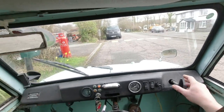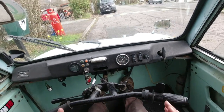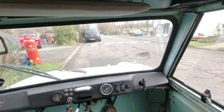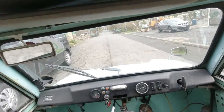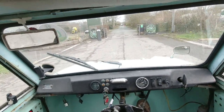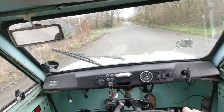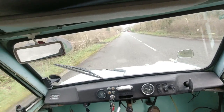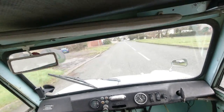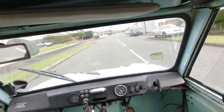Sounded a little sluggish because she's cold — she's been sitting a while. Handbrake off. So that is braking, got the indicators here, throttle here, no need to worry about clutch — it's a centrifugal clutch, waits to spring out, and everything works automatically. Check blind spot as best we can, build up the revs, the clutch engages, and away we go — over the speed humps. So it's actually quite an easy drive — you just stop by leaning down on the handlebar. That was my biggest problem in the tuk-tuk, I kept forgetting where the brake was. But speed builds readily here. That's us at the 30 mile an hour speed limit. It does feel more stable than the tuk-tuk, and I think that's purely because I'm sitting that much lower down.